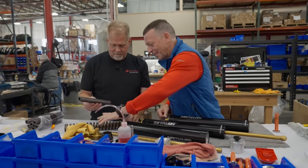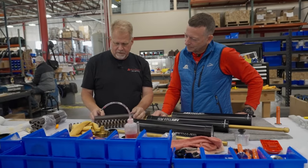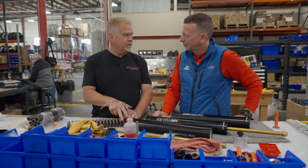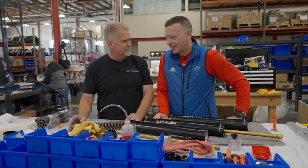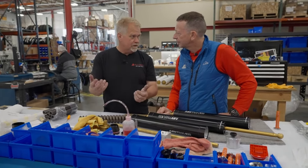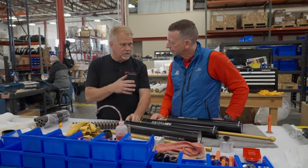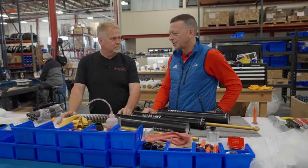That part at maximum travel is the stop — it stops the spring just before coil bind. Coil bind is bad because when you coil bind and keep pulling, you break things. That spring becomes not a 700-pound-per-inch spring anymore — it becomes limited by the tensile strength of steel, which is something like 90,000. A spring that bottoms out all the time is running over 100 percent stress. A typical off-road spring running at 80 percent stress has about 5 million cycles in it. Take that same spring running at 100 percent stress and it has less than 1 million cycles.